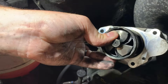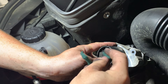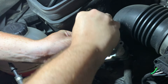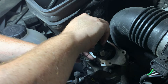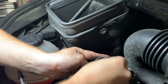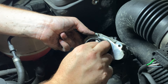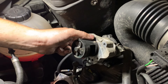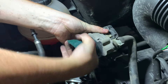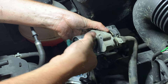See, that's coming up really clean right there. Scotch brite pads are great for a lot of things. Scrub the top part and get right down to the front. Now it's nice and clean and shiny. You've got a really good return on the valve — it's snapping back to the full closed position the moment I let it go. For the outside of the body, I take a bigger piece of scotch brite and go around it to clean some of the carbon buildup off. It just makes it go in a little bit nicer and come out next time a little bit nicer.